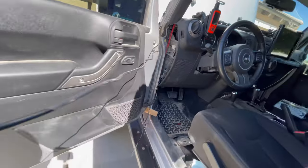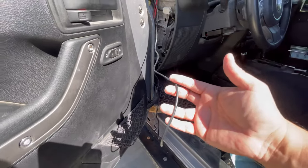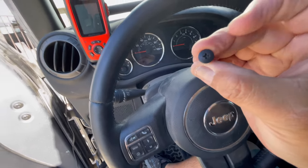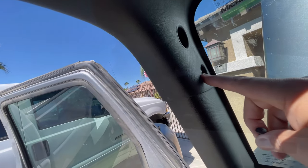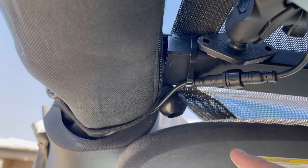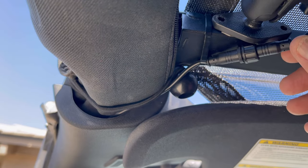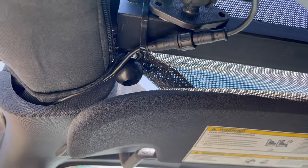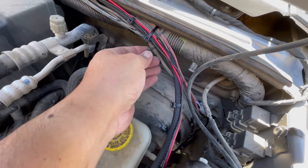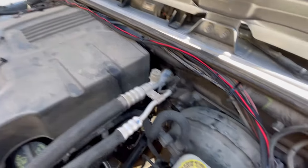This will definitely reach even your back sports bar where your speakers are at. I'm going to tuck it away in here to keep it out of the elements and the heat. Now I just have this one little Phillips that goes right in there. You can see the zip tie I've got in case this 30-pound tape decides to let go — this will hold it in place and also help tuck the cable up close. I'm zip tying everything together to keep it neat and keep it from moving. I zip tied this entire branch to that branch, which is going to take it all the way to the battery.